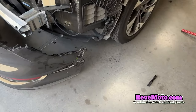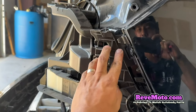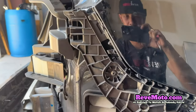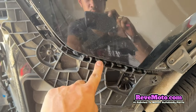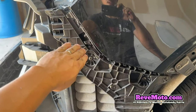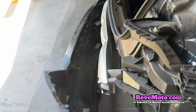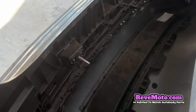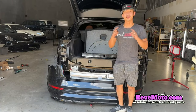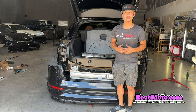You guys can see the bumper is already off. Here's a closer look at that bracket. You guys can see the hard parts on top right there — that's going to be the hard clip. It's going to be like a bunch of clips holding this bumper together — something you guys have to push up on. If you guys push up on those tabs, it'll release the bumper. Follow that bracket and you'll see a lot of the clips I'm talking about. Back here you can see that's the thing holding the bumper up too, where we took the 10 millimeter bolt with the extension off. That's how you take off a 2022 Audi e-tron rear bumper. If you guys have any questions, comment down below — I want to answer all those questions for you. Thank you guys for watching.